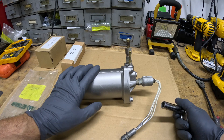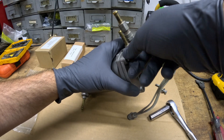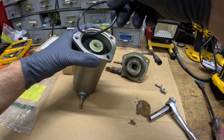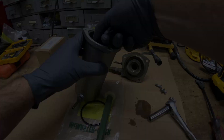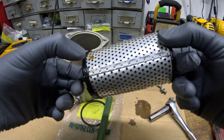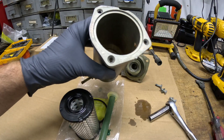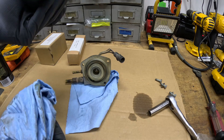I cleaned up and painted this fuel filter housing, and now I'm actually going to take it apart and get the fuel filter and water separator out. I'm wearing gloves just in case there's fuel still in this thing because I don't want to smell like diesel. You can see some dirt and stuff at the bottom, and whatever that is — it's squishy and gross. So that's something that came through the fuel system and got stopped by the filter. I'll spray out the housing with brake clean and then wipe out the inside with a shop towel.